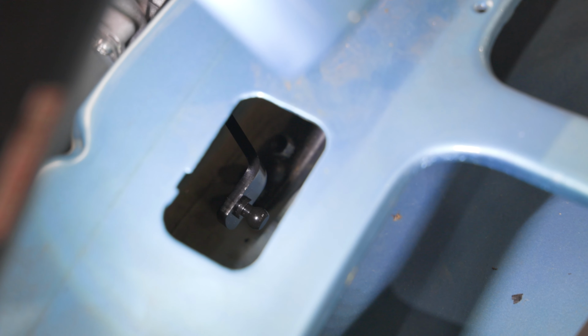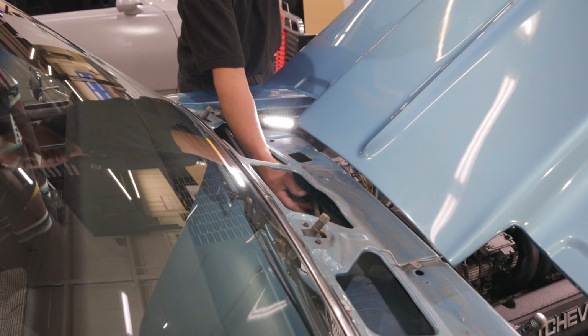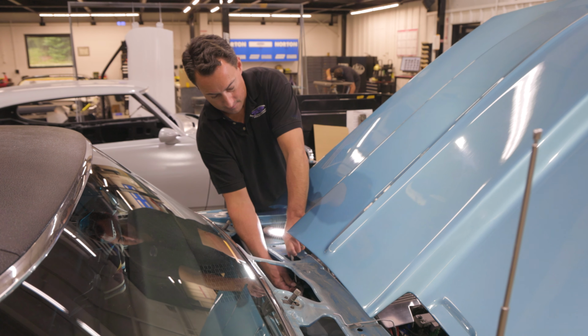Attach the new Pittman arm to the original wiper linkage. Keep in mind that the SelectaSpeed wiper kit is shipped with the Pittman arm in the parked position. Do not move the Pittman arm by hand to attach the wiper linkage. If the Pittman arm is moved from the preset position, it may result in the wiper blades stopping in the wrong spot on the windshield.